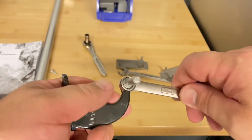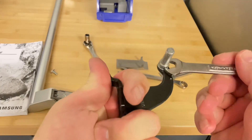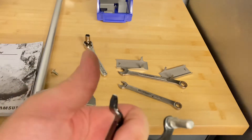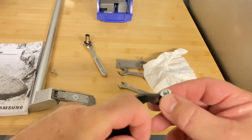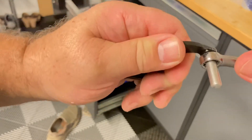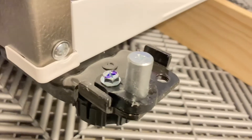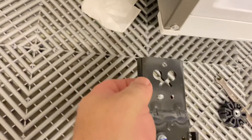10 millimeter. And if it's a regular thread, lefty-loosey-righty-tighty. Broke loose easy. It has some silicone on it, so it's a little greasy and hard to get a hold of. It looks like we just turn it around and screw it back in. We have to stab this into the top of the door, so that will have to stay out. Here's a bracket that's got to come off - three screws. Now we get to move it from the left side of the freezer over to the right side.